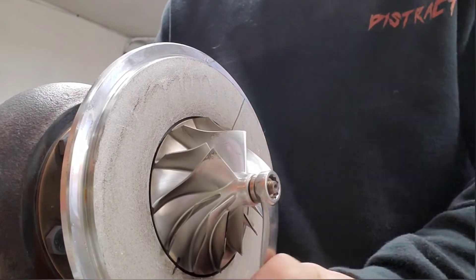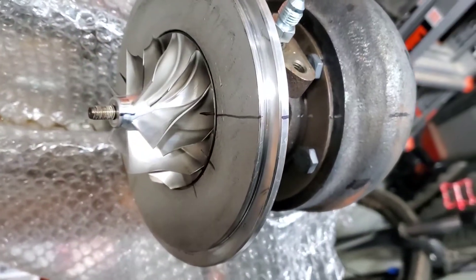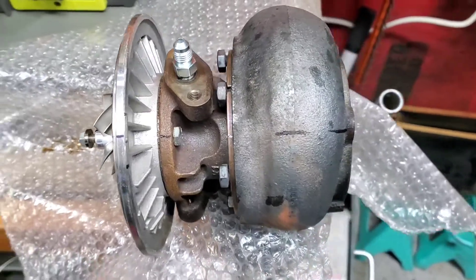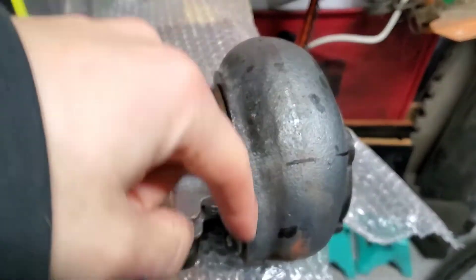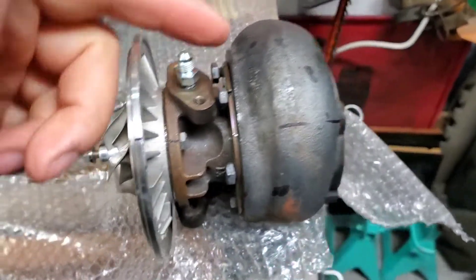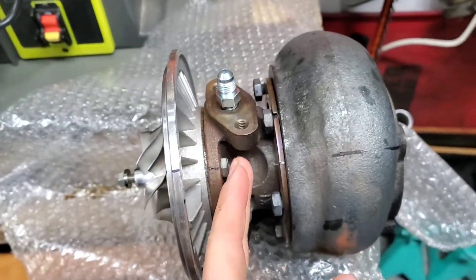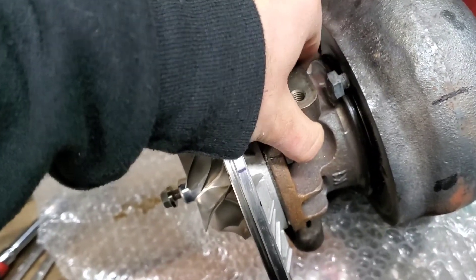It's coming off pretty good now. Double-check to make sure all your lines are still there before taking anything else apart. Now that it's all lined up, go ahead and take the bolts off the center section — because if you go to tap on this shaft, you're going to have your turbine wheel in the way and won't be able to get it out of the housing. Take this off and put your bearing section in the vise; the whole center section comes out just like this.